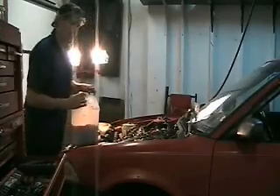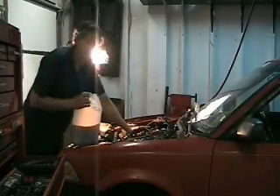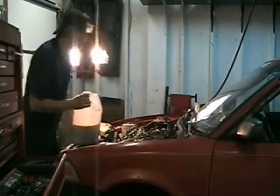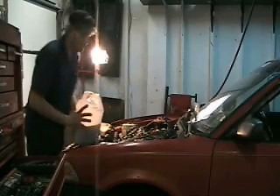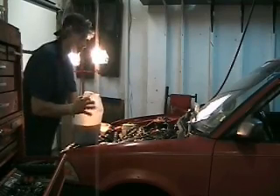The next thing we want to do is top off all the fluids. Don't forget to add oil, for sure. But also it's very easy to forget that you need to add coolant, and that you've got things like spark plugs loosened or removed because you were turning over the engine. So double-check all that. I'm going to go ahead and top everything off with fluids and then get ready to start it.